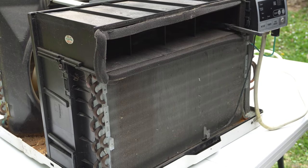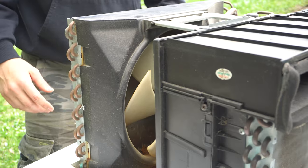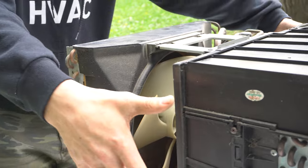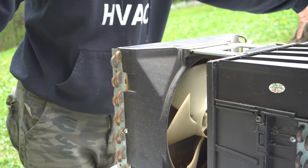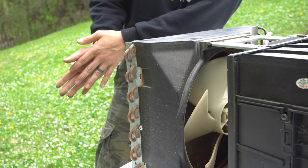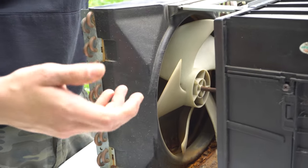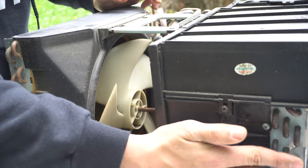As that fan is running, it's sucking air in through here and, by means of the Freon or refrigerant, it's cooling that air off, recirculating it, and pushing it back out through the top to give you cool air. So it's sucking air in from your house and pushing it right back out. At the same time, outside — with the case on, this is the side sticking outdoors — there are grates right here. It's sucking air in from the sides and pushing it out through the back.